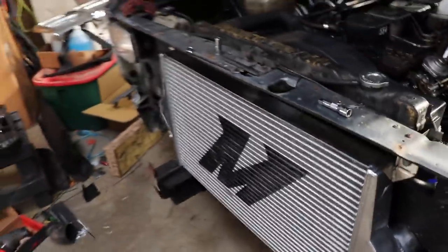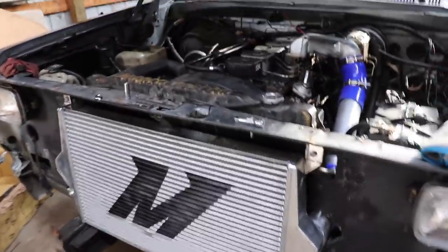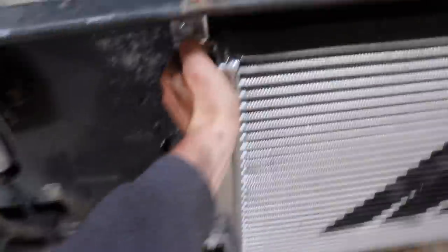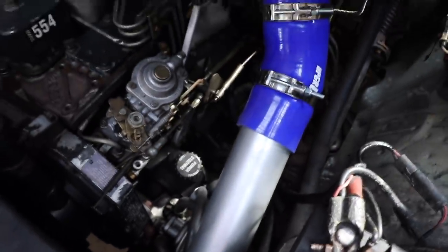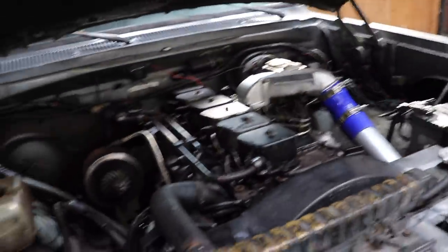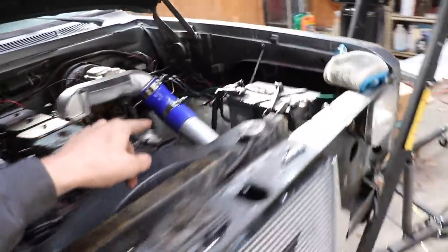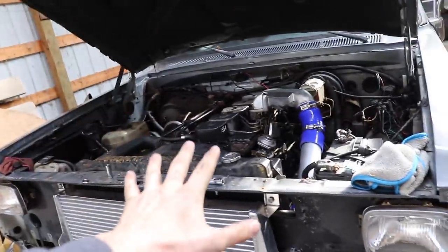This is what we have done so far: we've got the intercooler hooked back up, and this time it's probably going to be staying in. It's a really snug fit so it's not the easiest thing to line up, but it's good because you can't move it. We got that all bolted in top and bottom, both sides. We've got the intercooler piping that goes from the intercooler up to the intake all mounted up with the new boots and stuff — everything is solid as a rock. The only things we still have to do are get the compound turbo kit hooked up, get the injectors put in, the 3,200 RPM governor spring needs to go in, and valve springs.